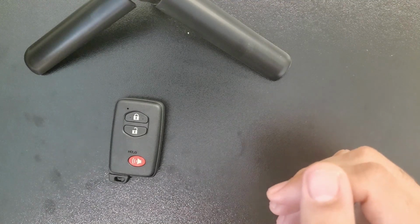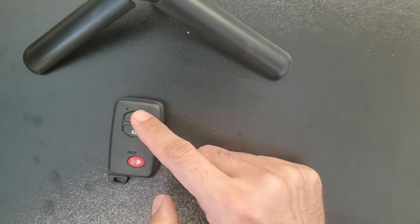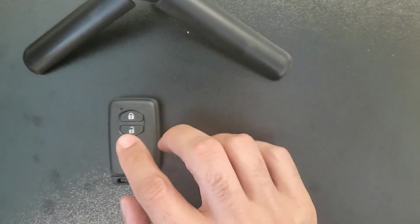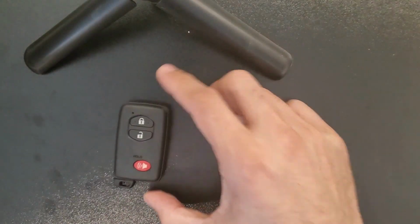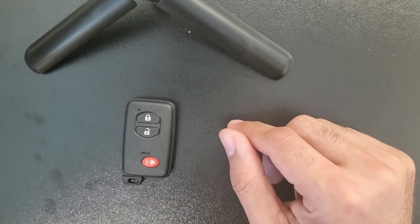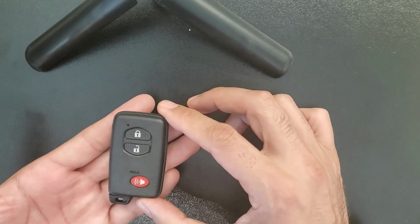The battery you will need is a CR1632 for those with 3 buttons, and CR2032 if you have 4 buttons, which includes also the trunk release. So it really depends which one you have. This one is a 1632. You can click on the link below for both of them, or CR2032. I will show you in a second how you know. You will see once we open the key fob.